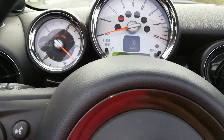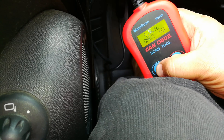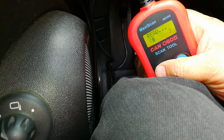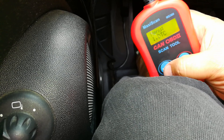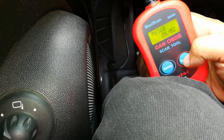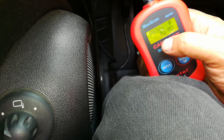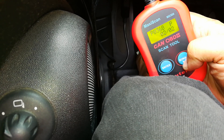We're going to go back to the scan tool now. With my scan tool plugged in and my ignition on, I'm going to show you what you're supposed to do. You want to hit enter and the scan tool is going to scan the car — it's pretty quick about it and it shows that it found two diagnostic trouble codes or DTCs. Hit enter, and if you want, have a pen to write down these numbers. I'm getting a P0368 and a pending code, which means it's happening and recorded, and another pending for the same code P0368.